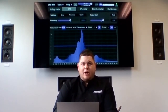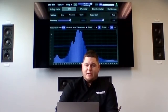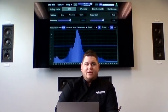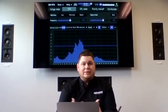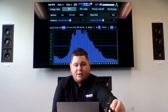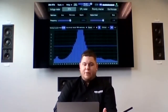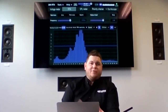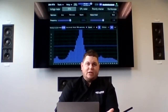Let's move on to the RTA. In the RTA feature, at the top of the screen I can see mic gain and the microphone as my input. Right now we're reading the RTA using the microphone. Up in the corner is a little 48V button — that's the phantom power supply for the microphone. A lot of professional microphones require 48-volt phantom power to operate. If you're using an AudioControl mic and this button is not turned on and lit up, the microphone will not work. That's the first thing we always recommend checking if you're not getting a reading.